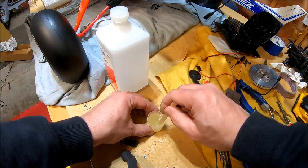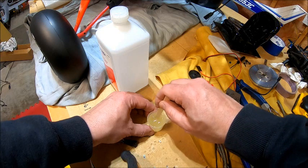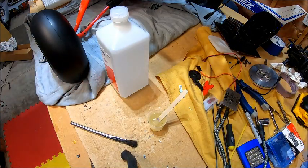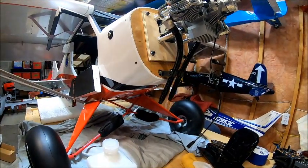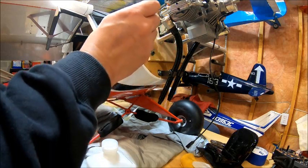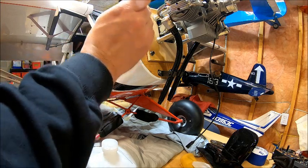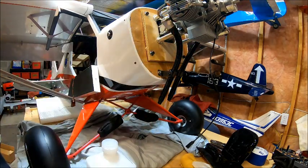You know it is all mixed in when it is kind of dissolved — there are no big clumps. I like to use 30 minutes because we are going to do this whole engine box and it is going to take a little bit of time. I don't want it to dry and get clumpy. Now we are going to take our acid brush and just come up here, try not to get any of this on the engine, and literally paint it. This seals that wood off so we do not have any issues here.